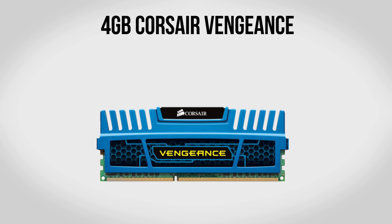For memory we're going to be using 4 gigabytes of Corsair Vengeance RAM. This is solid stuff that I use in my own build, and clocked at 1600 megahertz it's about the sweet spot for an Ivy Bridge based system like this. I'll be the first to admit that 4 gigabytes isn't a ton of RAM, so I do recommend upgrading when you can — this motherboard has 4 DIMM slots so you can bring it all the way up to 16 gigabytes. Sticking with the 4 gigabyte version for this build runs about $25.